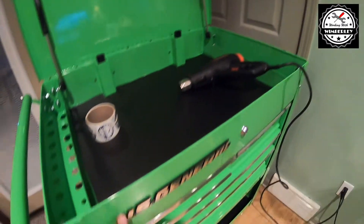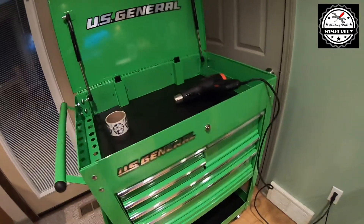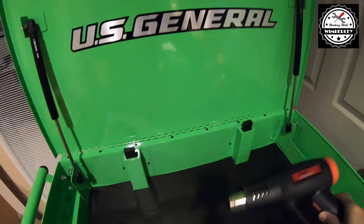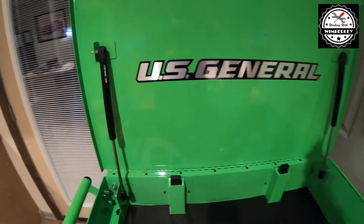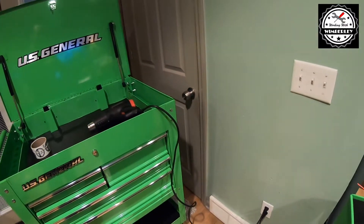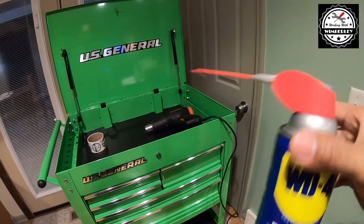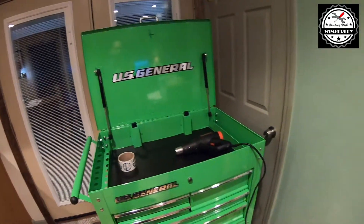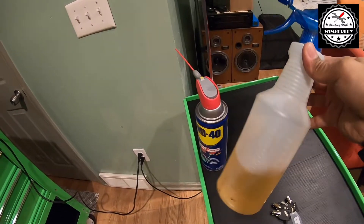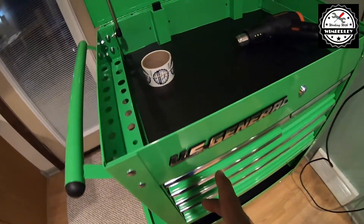This is an emblem with two-sided tape. It's going to be the same method I use on cars when I'm debadging. I'm going to get it warm with the heat gun — once it gets warm I'll be able to peel it off cleanly. There's going to be some glue left, and to get the glue I personally like to use WD-40, just keep rubbing it on there until you get all of the adhesive off. Once you're done using WD-40, to clean the WD-40 I just use some soap and water mix, spray it on there, wipe it down, and you're good to go.